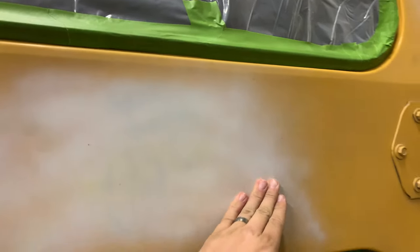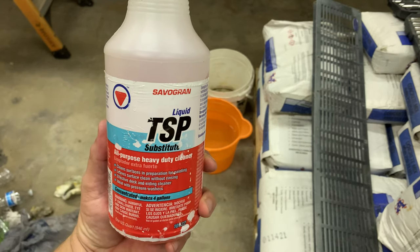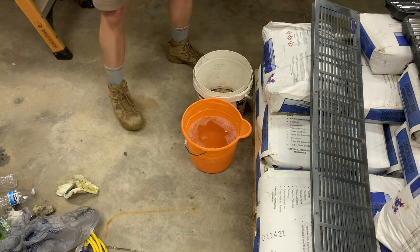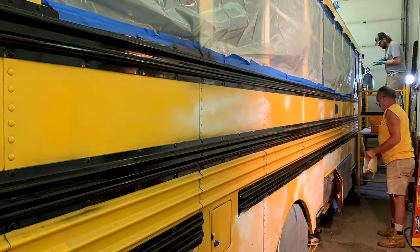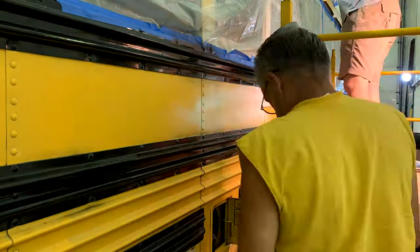Good morning. We just got to the shop bright and early — left the house around 6 and going to get ready to paint. We're feeling the bus: got a little dust, a little debris from the drive out from sitting in the shop working, so we're going to have to wipe that down. We're going to be using TSP — you might remember that from when we did the Henry's Tropical on the roof. We used that to clean the metal before putting the Tropical down. We're not going to do a full wash in here because we don't want the bus to be soaked, but we will wipe it down with a damp rag with TSP, clean it up, give it a couple minutes to dry, and then paint. We're going to start on the side where we did the test with the door and paint that whole passenger side — we'll do one side at a time.